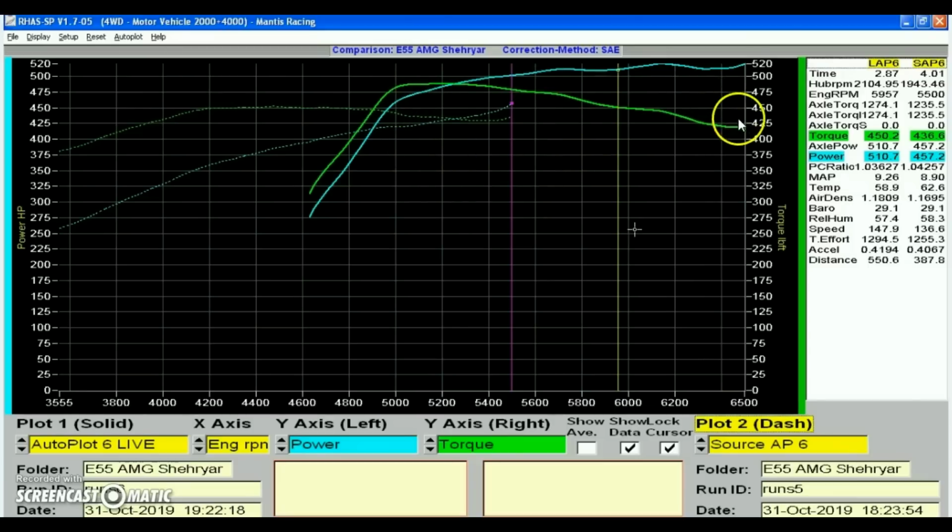So yeah, since then, making this correction, giving another 2 degrees over here, I believe that would make the difference between taking this torque curve flat from all the way till this point, all the way till here. So basically the torque curve on this engine is flat all the way from 4,000 RPM pretty much all the way till red line. It's just a straight flat torque curve, and the horsepower level keeps going up. Right now the horsepower is at 520 because obviously it's at a much lower torque, but I believe the final number would be 550 or even higher than 550, to be honest.